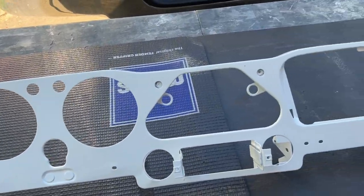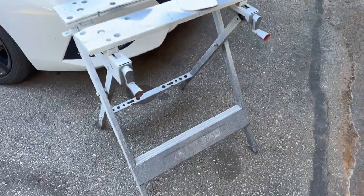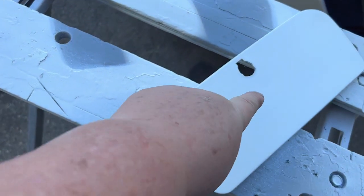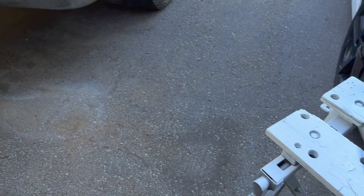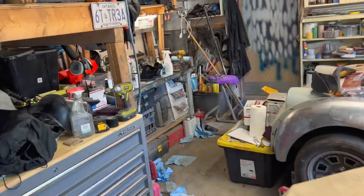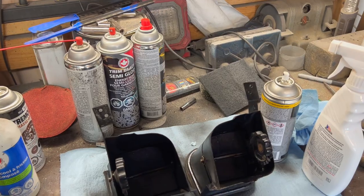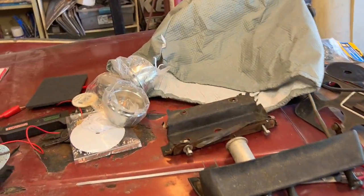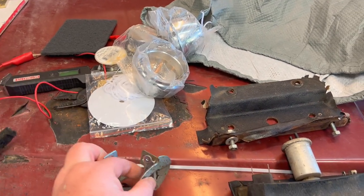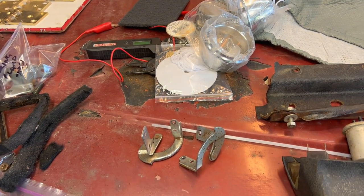Just taking a quick look at the dash — it's ready to be assembled. The door is over here just drying, with a slight dent that probably should have been bodyworked, but it is what it is. We're ready to start the reassembly phase. The other vent tube is reassembled and sitting on the workbench. There is a particular order to assemble this in — basically the reverse of disassembly. The glove box door hinges need to go in first because you cannot get them out otherwise, as these hinges need to go through the slots in the dash before the vent tubes go in.